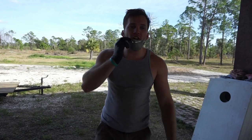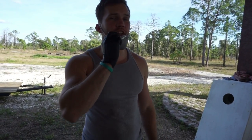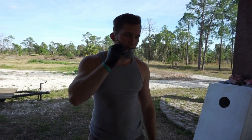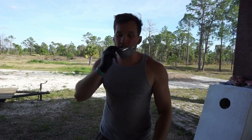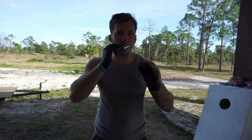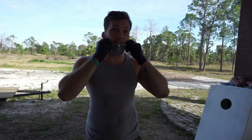Got my respirator on. We're going to be trying to start off shooting at 50 PSI. We've got a little piece of wood over there as our test panel. I'll show you guys that. But yeah, been shaking for a while now, so now we're ready to just screw on the gun, plug in, and get spraying.